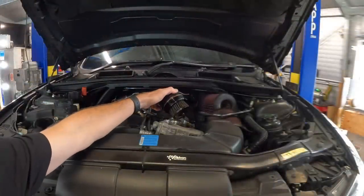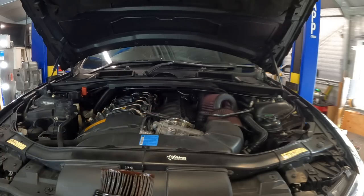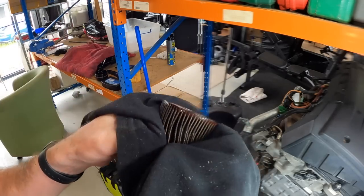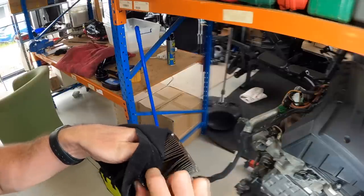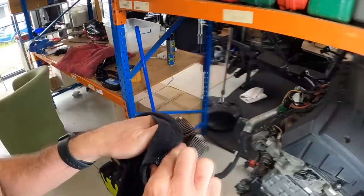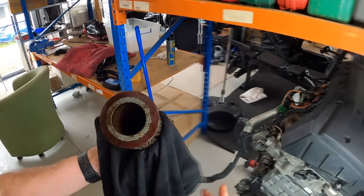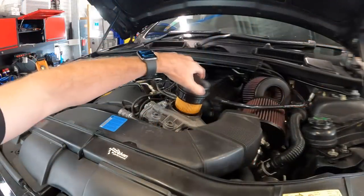I should have mentioned I cracked this before I did the sump plug. We'll have a quick look at this filter, see if there's anything scary in there. Trying to make a minimum amount of mess here. My fingers are filthy, but the oil is pretty clean in there. Considering what the engine's been put through lately, this looks pretty good. The oil is cleaner than I thought it was looking through the sump. I'm going to put a fresh one in and close that cap off — nothing scary. New O-rings, filter, and she's good to go back in.